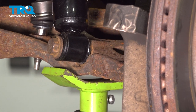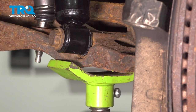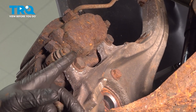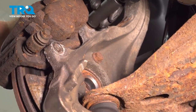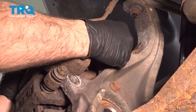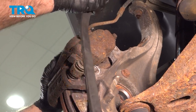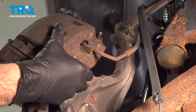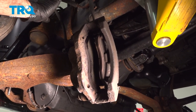Ours is spinning so let's go ahead and put a wrench on that. Using our 16mm wrench, secure that end link. I'm going to put our jack under that control arm and raise it up. We're going to slightly compress the suspension so we can remove this bolt. Using a 21mm socket, let's remove the two caliper bracket bolts — one here, one on the top. The whole caliper and bracket with the pads will now be loose, so you want a securing strap. Let's pull off this whole unit and secure it up to the frame area so there's not a lot of tension on this rubber hose.